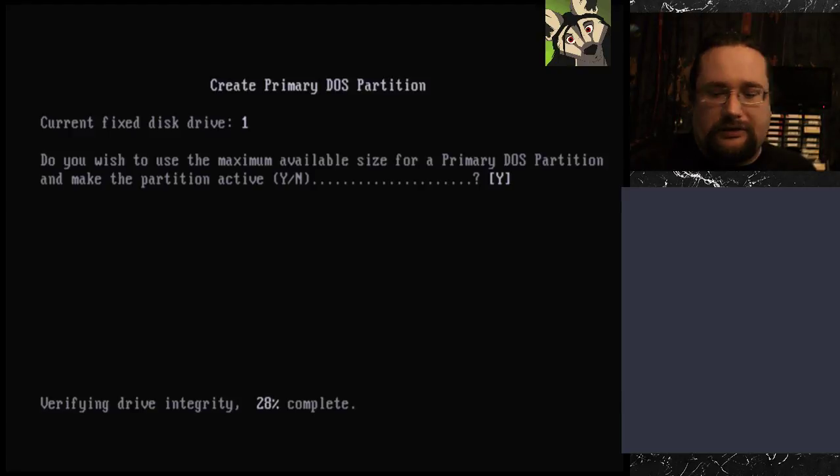The system works. I mean, I'm only using like the primary channel. No idea why the secondary channel IDE, the ATAPI, doesn't detect properly, so doesn't detect the CD-ROM. I guess you could still plug it in and just disable it and use the Windows drivers or use a boot disk or something, but I'm lazy. I like things just to work from the get-go.